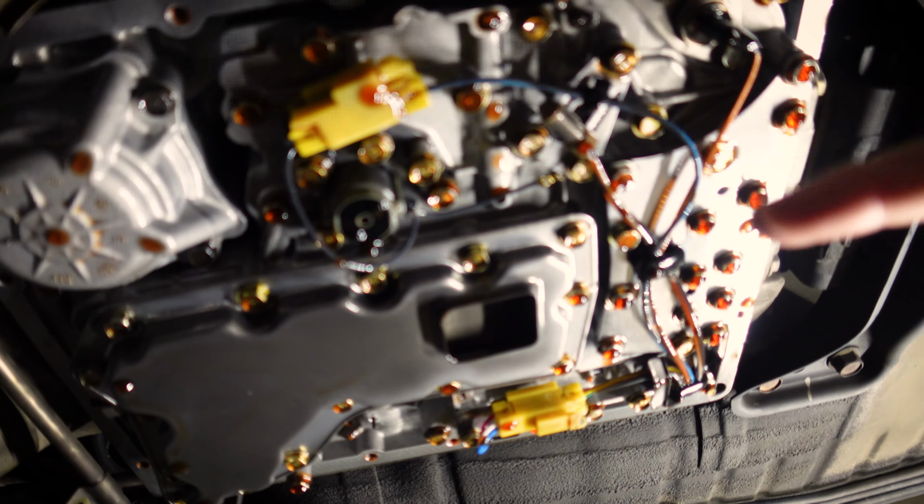All right, so in terms of parts, first up, we've got transmission fluid. I am using Castrol Transmax Z. I have heard that in the R34 gearbox, this gives better quality shifting, less flaring, sharper shifts, all that sort of thing. So considering that I am having some issues, I thought I'd spend a bit more and get some decent fluid. The standard fluid is the Nissan Matic D. I don't know whether you can get that in Australia or not, but Castrol's nice and readily available, and lots of people were saying this is a reasonable oil.